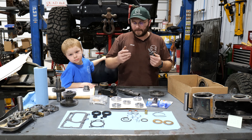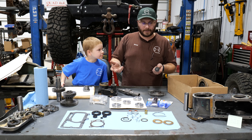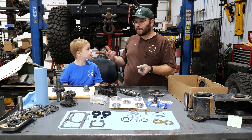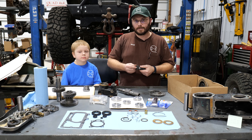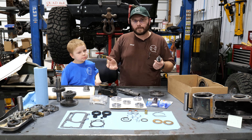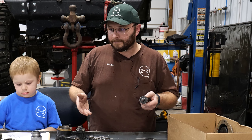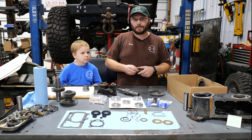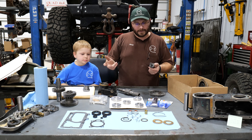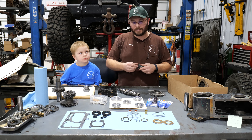As long as you hear anything funny — funny noises — make sure you get that checked out. Don't be afraid to drain the oil and check for glitter. It's normal to have some glitter as these break in — machining tolerances aren't as tight as some other applications, but for what the vehicle is, they're great. I've had glitter in the first couple of oil changes and nothing failed. If there's glitter, change the oil. If there's more glitter, you might want to check on it, especially if it's starting to make noise.